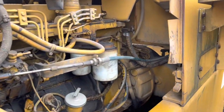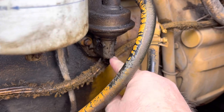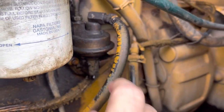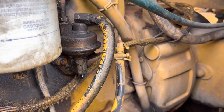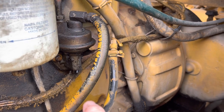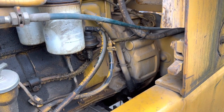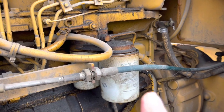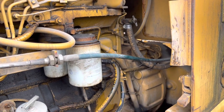It's a little chilly out here today. Right there is the fuel pump — it has a little mechanical pump on the side right here, but I don't think it's doing much. This thing is an '88, so it's old. I tried pumping it up manually and it's not doing anything — I'm not getting any fuel into the filters. This right here is the return line, and this is the main line coming from the tank. I'm guessing it's gonna be the fuel pump. Let me get this line off.